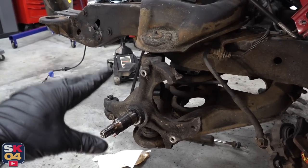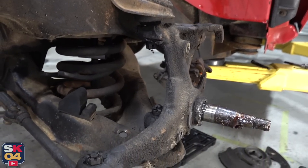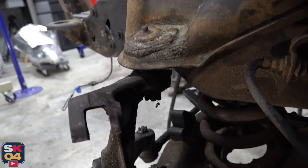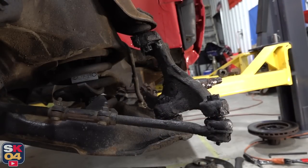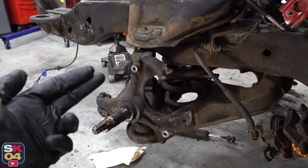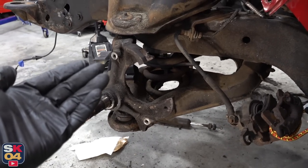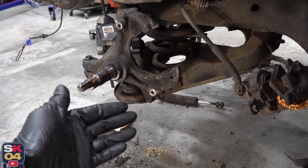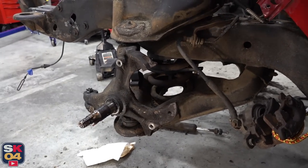There's more than one way to go about removing ball joints. You can get tools that will damage the ball joint but get the job done, and there's also tools that get the job done and help preserve the ball joint if you were going to reuse it. If you have any stubborn ball joints, I found out that smacking a specific area of the spindle or the control arm will actually shock it and make it come out. Right now we're at the point of jacking up the lower control arm to release a little bit of tension so I can take off the castle nuts completely, then drop the suspension down ever so slowly. Watch out for that coil spring — we'll get that out of there and then remove everything else.